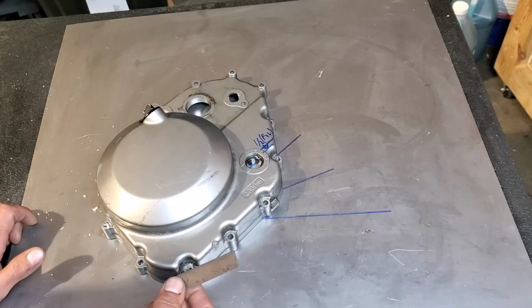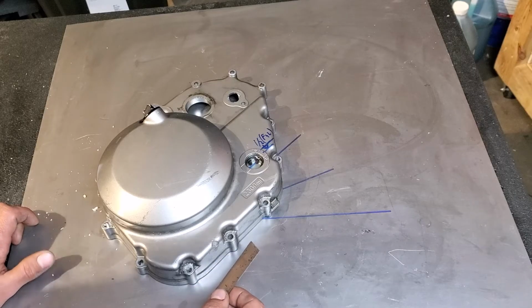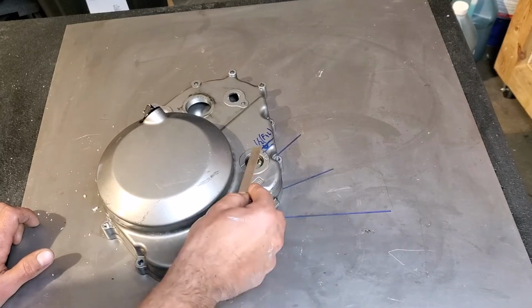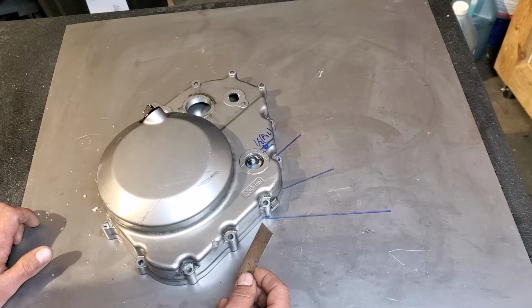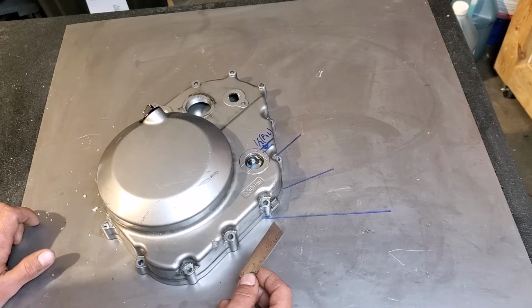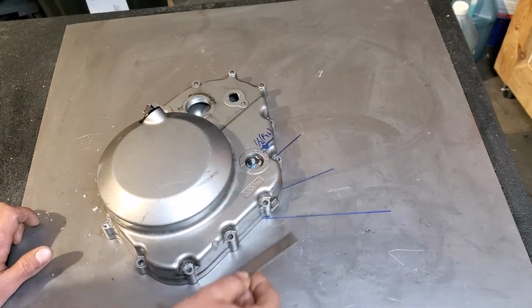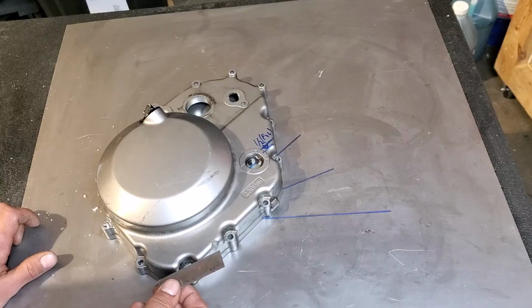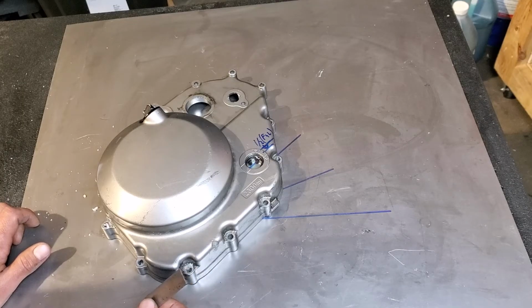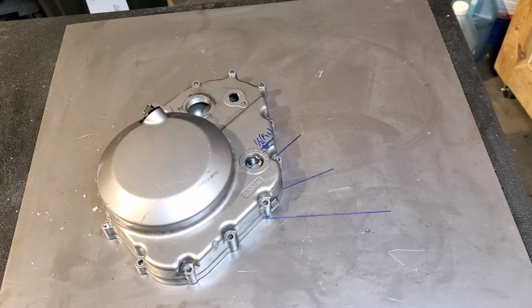Now, this made a couple of assumptions. This obviously made the assumption that no oil went anywhere else in the motor, which is not actually the case. So this would get drier earlier. It also made the assumption that as the motor is running, the oil level stays in the middle, which is not the case. Obviously, if you start the motor and watch your bike get vertical, oil level will come down a bit. But I feel like this addressed the concerns of not managing the constant volume, as well as the concern of the pickup tube that went to the oil pan.